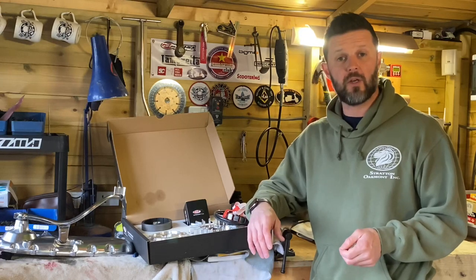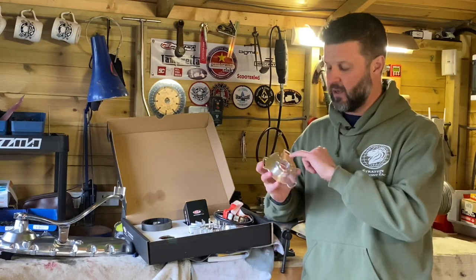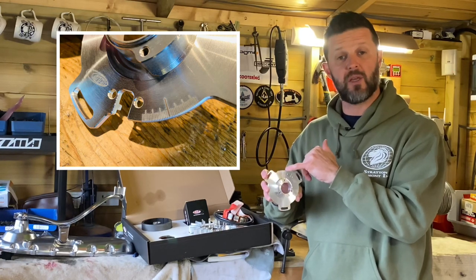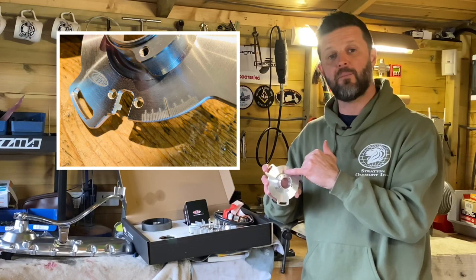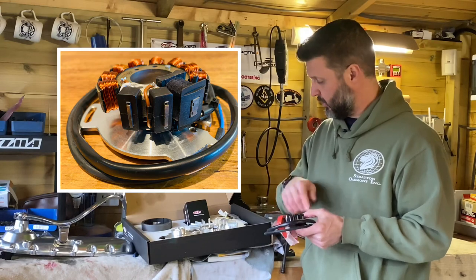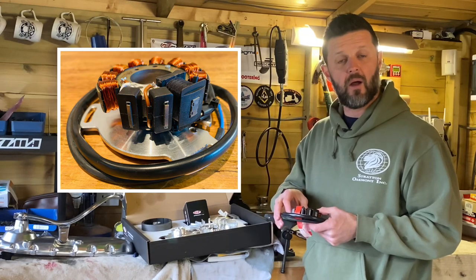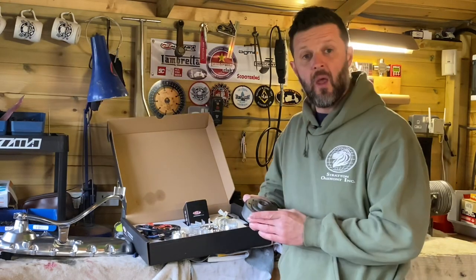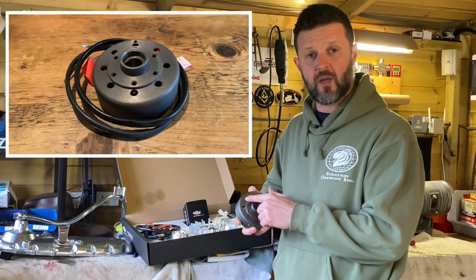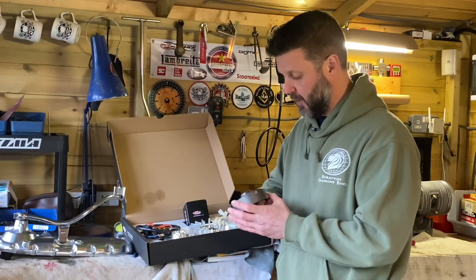SIP tell us the kit has enough power created at tick-over to fully illuminate the lights. They also have usefully marked increments on the stator backing plate for setting ignition timing — this is incredibly useful and not something you often see on practically any other Lambretta stator plate. There's also a rather unique pickup design to eliminate problems with centralization between the pickup on the fan and the stator itself. The fan is a one-piece unit, so none of the boss rivets you'd normally get — SIP say that helps to reduce vibration, which on most Lambrettas will be a blessing.